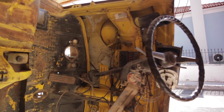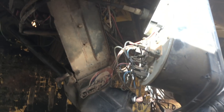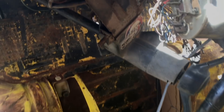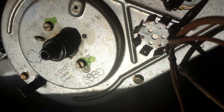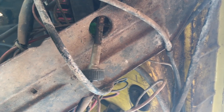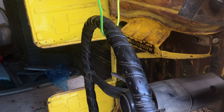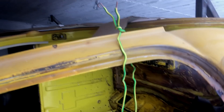Inside the cab, this arm locates the steering column fore to aft. It's just one bolt on the front panel of the car, inside the front panel. Then I released the speedo drive off the back of the speedometer — this is just the same as most, you could just unscrew it, very, very easy. I suspended the steering wheel from the A pillar just as a precaution — I didn't want it to fall and break some switchgear or something like that. The least parts I have to find for this thing, the better.